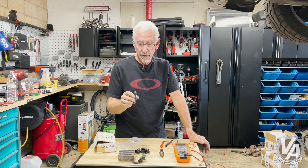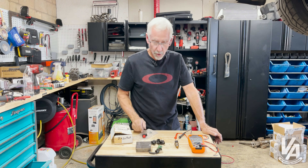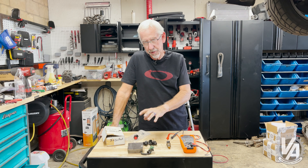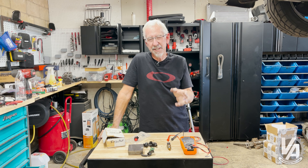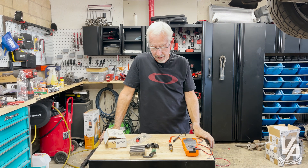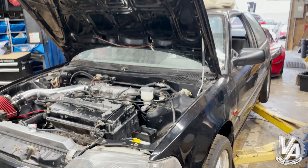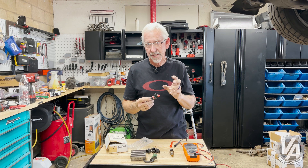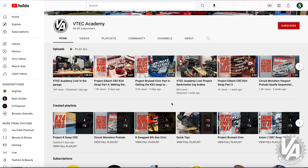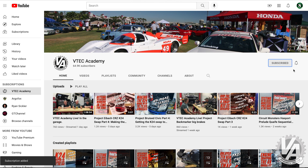Then I can run these RC injectors — they're basically brand new and clean — so I'm going to put these in and use them when I get the car tuned at the dyno next week. I don't want to go into the differences of why some injectors are low impedance and some are high impedance; it has to do with the way voltage is delivered to the injector. But suffice it to say, you need to know what you have and make sure on these older swaps you're using the right injector so you don't damage your ECU. I hope this has been educational — please think about liking and subscribing. We'll see you in the next episode of Three Minute Thursday. Thanks very much.